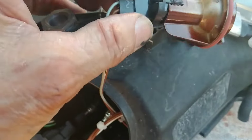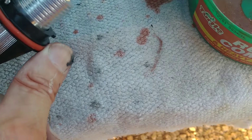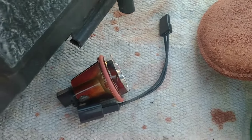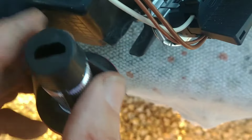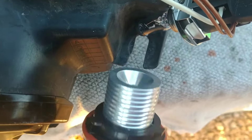At this point you should be able to just pull the little plug out. The new bulb looks a little bit different than the old one. I'm counting on it fitting in there — it has the same type of connector that the old bulb did, so this should connect directly without needing the little extra wiring harness they give you. So I'm going to plug this in. It looks like it's going to be very snug because of the rubber surround — it'll be a nice, tight, waterproof fit. I should be able to slide it into place, and hopefully this new longer nose will take it right up to the end there.